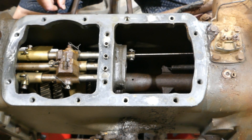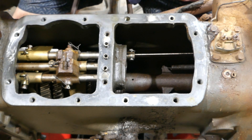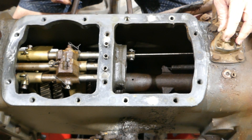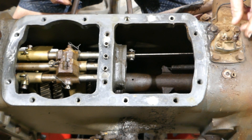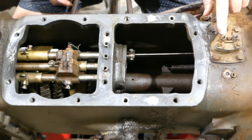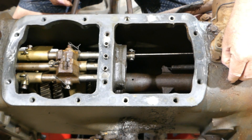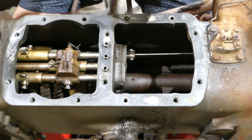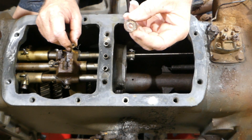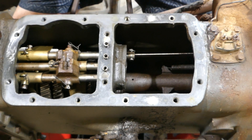What we'll have a look at is the starter switch on this wasn't working, so I had to short it out. You can see the colour around the bolts there — wherever there's rust on these fittings, that means there's been a loose connection sometime in its life, and that's where the resistance is. You can see this washer there that was used — it's all no good, it's had the heat through it.